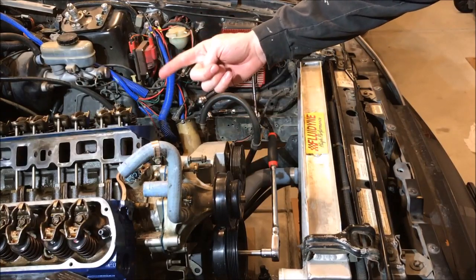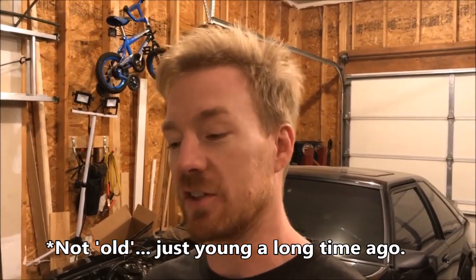One more tip: do not prime your oil pump before you set valve lash and preload. You don't want to do that on a hydraulic lifter — that's something the old guys did with solid lifters, and it is not something you need to do with these. In fact, it'll throw off your measurements. If your motor's been sitting for a while, you're good — the oil has probably bled out a little. You just don't want to pump the lifters up using the oil pump, as that will give you false readings. If it takes more than one rotation to reach your desired preload, you'll probably need shims — a 30-thousandth shim usually eliminates about a quarter turn. If you can't make it up with that shim, you may need different length push rods.